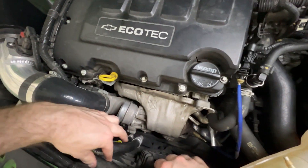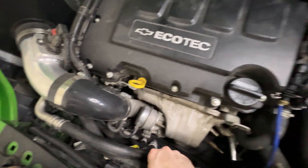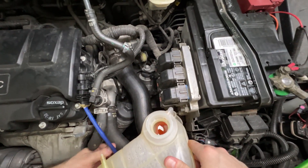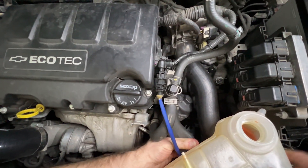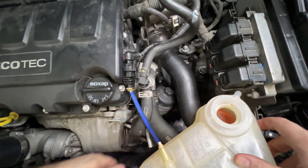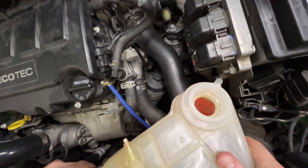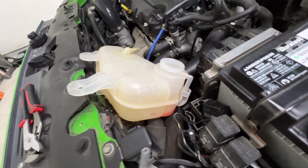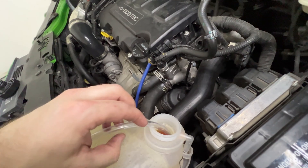You want to disconnect your coolant hose from this clamp down here. Push it down as far as you can, and then squeeze on that coolant hose. Remember, the goal here is to get as much coolant on this side so we can remove it. Give it a tilt — you can see all that coolant we're about to get out of there. Back to the hose — all that yummy coolant we're going to get. Sticking that down in there.